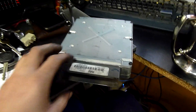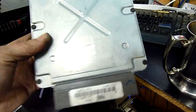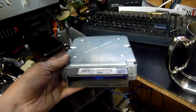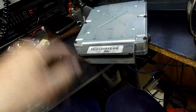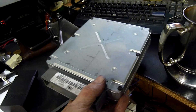I thought I'd pull the ECU out. I can see it looks like a watermark, a tide mark in the connector there. I wonder if it's been hit with a gurney high-pressure cleaner at one point. The car's very clean for a Western Australian car - most WA cars I've seen are covered in red dust and oil. The watermark on the bottom of the connector tells me something might have gotten in here. These ECUs are known for failing anyway, so it wouldn't surprise me in the least if it's just gone belly up on its own.